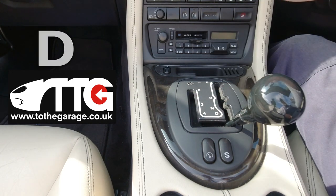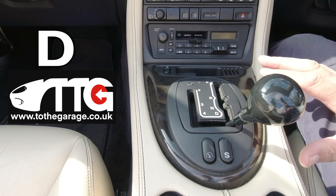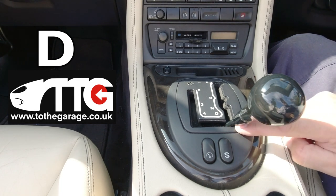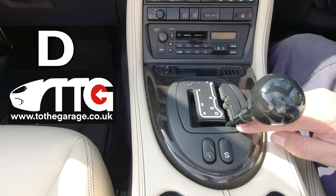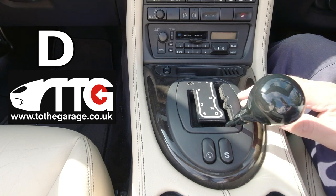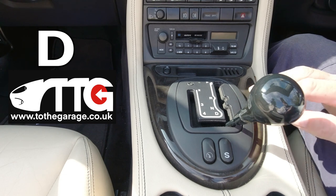Pull it back to drive, and depending on how we're driving and the circumstances being relayed by various sensors around the vehicle, the car is running programs and will select the right gear. My car is a 5-speed gearbox. It will select the right one of its 5 gears for the circumstances that it sees and select the points at which it changes gear based on torque, effort, revs, etc.